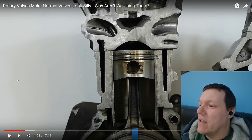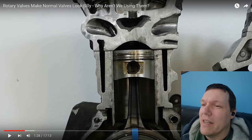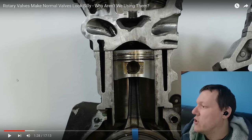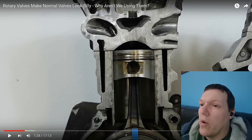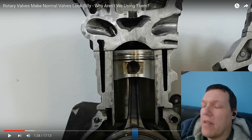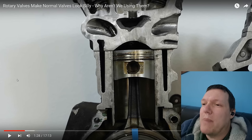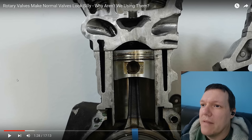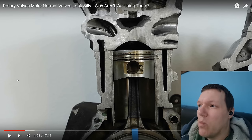An engine running — let's just say the valve train is about 10% or 25%. A lot of people have said it's 25%. It's 25% not of energy, not of engine consumption — it's 25% of the friction. So how much is friction robbing from an engine? Let's just say a 10 horsepower engine, and say the friction losses are one horsepower — a tenth. It is a quarter of that tenth, so it's a fortieth of the engine's power output. So if you were to recover that, and it goes on to talk about rotary valves — that's if you recover all of it. These things — it matters what we're talking about here. A gain is a gain, but it depends what those gains cost you.